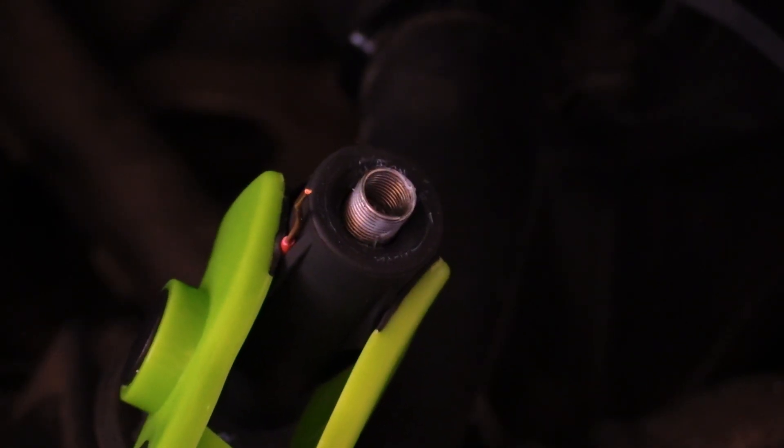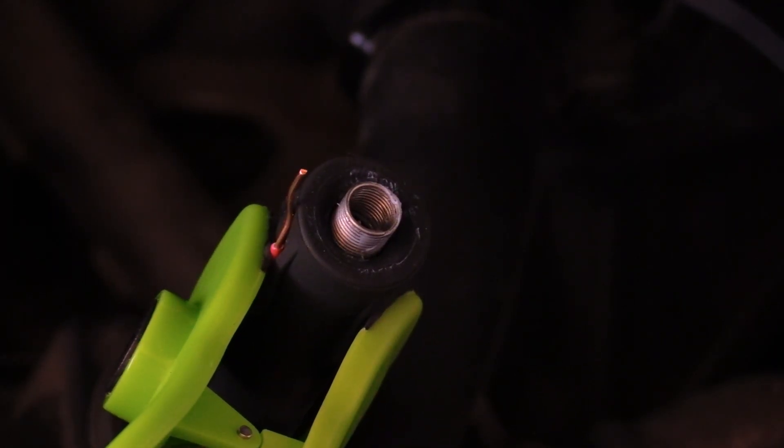So you just saw four very big sparks jump across that gap there. So we know the ignition system is producing spark. If it isn't producing spark and you didn't see it sparking, nine times out of ten our go-to fix is going to be your crank angle sensor. Go ahead and change that and then try this test again. I have a link down below in the description to show you how to change a crank angle sensor on two different vehicles — one's a Yukon and the other one is a Ford Focus, so you can choose which one you want to watch.